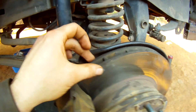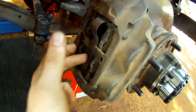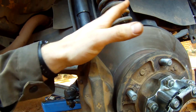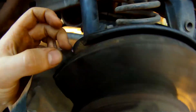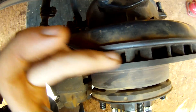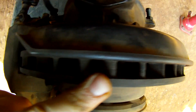They're more or less the same. On the front we have ventilated discs and four-piston calipers. The caliper's in a slightly different position — it's in a vertical plane here rather than up here. The disc itself is a bit larger and definitely a bit fatter. The cross-section maze of the construction of the disc is quite impressive, so the cooling will be very good. I can actually see through part of the gaps to daylight below.